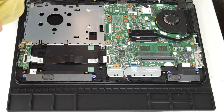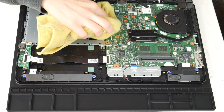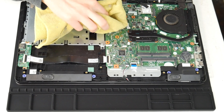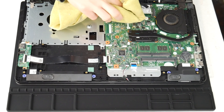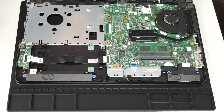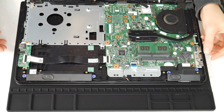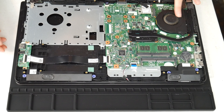I'm going to use my microfiber cloth with a 70 to 90 percent alcohol solution and wipe off any liquid spills I see on the board, inspecting the whole board and gently cleaning off any liquid, because this can make connections that aren't supposed to be there. If you remember any specific spot getting liquid on it, you may even need to take off the motherboard and check underneath, making sure to clean it and ensure it's dry of any alcohol before turning it back on, because this is a big cause of overheating.